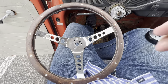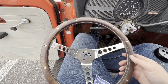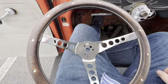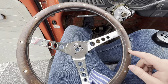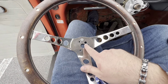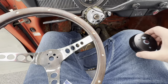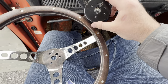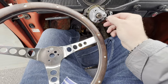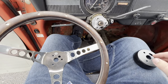All right, so the wheel I'm going to use is this really old wheel. I've had it for a long time and I'm not sure of the brand — there's like an S in there. This is the one we had on the 70 model F100. This one has the horn button hole right there, and obviously my wire comes out in here. So what I'm going to do is run my wire through the plate here and then bring the wire around and up where it needs to go in order to hook the horn back up.